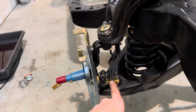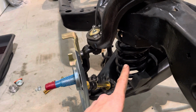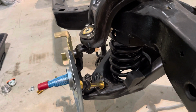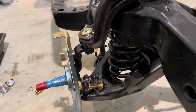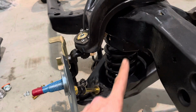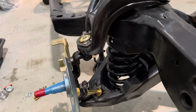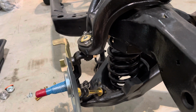And I've got the new sway bar shaft in there as well. We went with the big block springs, also with AC. So it was definitely a little bit harder getting those springs in there. Had to use some ingenuity and use some straps around the frame and a 4x4 underneath there, as well as some spring compressors, just to have some added safety.